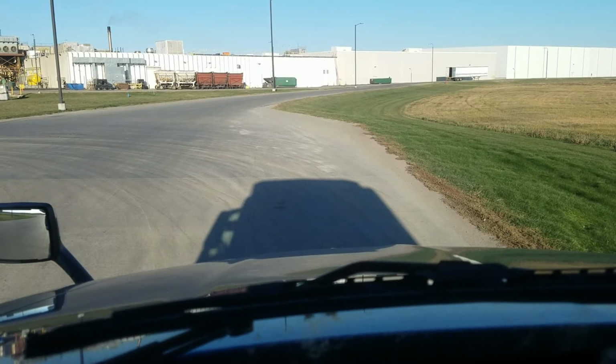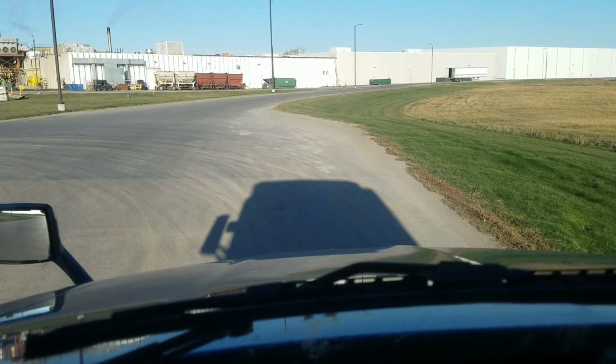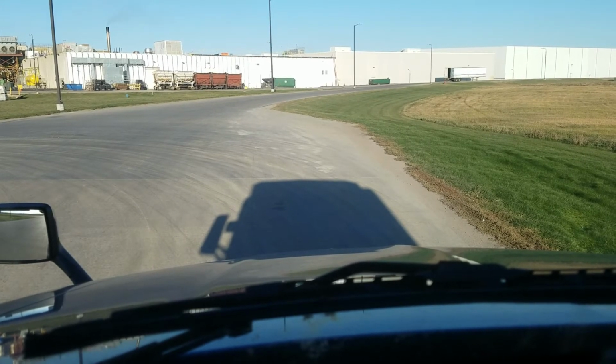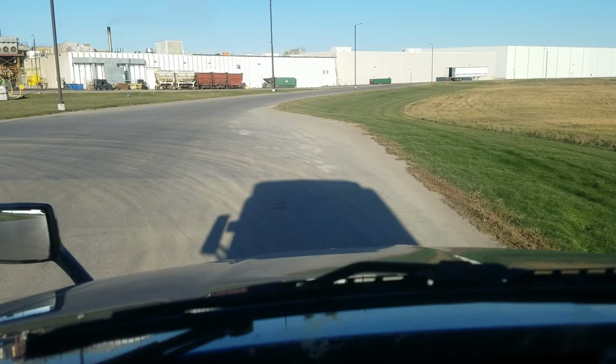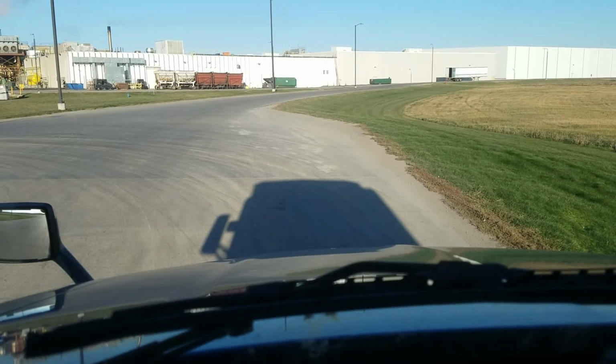Did you mark your pinhole by chance? The one right behind, correct? No, if we're going to adjust our weight back to the trailer, we're going to pull the tandems forward, correct? So we're going to have our trailer brake set, and we're going to back onto our tandems one pin. So we're going to move backwards while the trailer's set. Release your tractor brake.